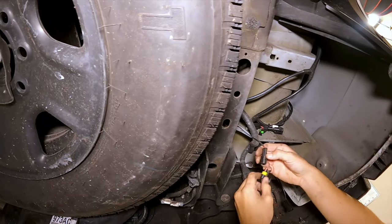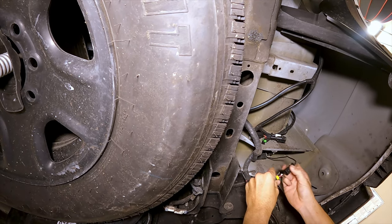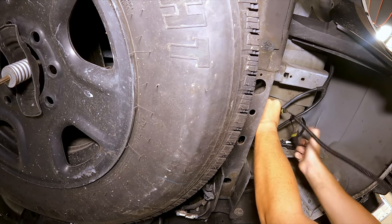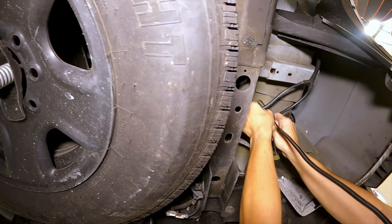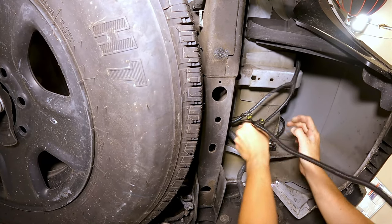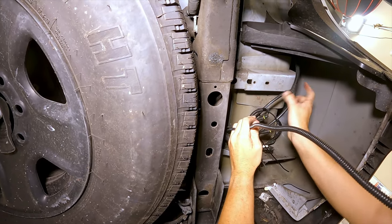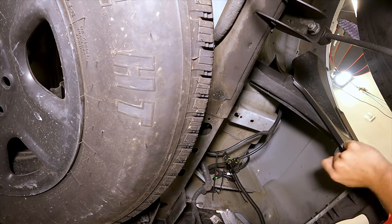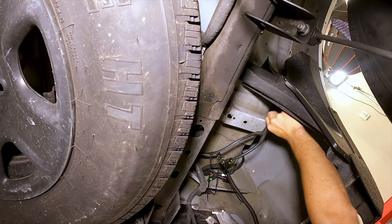So back to the tailgate, we are gonna go ahead and take our harness, plug these two clips in. We're gonna wanna zip tie a couple of these out of the way. You can take a couple zip ties, just put this on whatever wire loom you can find, not really specific. Go ahead and do that. So we're all set to get our wire loom to go up and over the fender well here. So we're gonna route this all the way back. And we're gonna send this up and over the fender well here. So you can see this harness right here, that's what we're gonna follow.